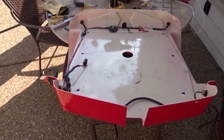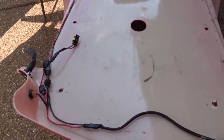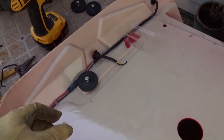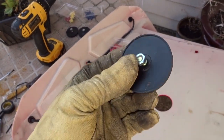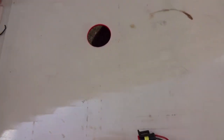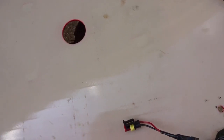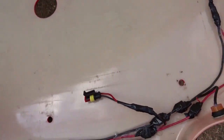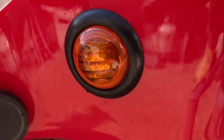Here we are looking at the underside of the deck. I'm wrapping up the install of the LEDs and the wiring harness. What I did was just take out the basic reflectors that were mounted on four points at the rear end and side, took a paddle bit and drilled the hole out to three-quarter inch, and bought three-quarter inch LED marker lights from Amazon — link is in the description below. They fit right into the hole nice and clean.